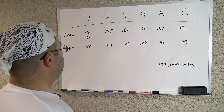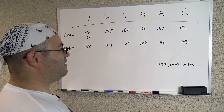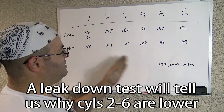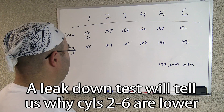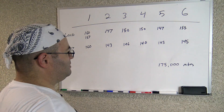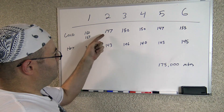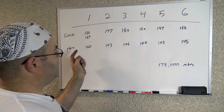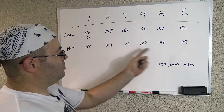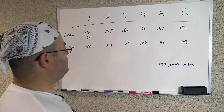I'm a little concerned that cylinder one is showing almost 20 PSI higher than the other cylinders. You really want to see consistency between all the cylinders, so that's kind of an issue. But for 175,000 miles, what more can you really expect? You'll notice we are showing different numbers between the hot and the cold test — the hot numbers are more realistic for what your actual compression is, and that is why they tell you to do it when hot.